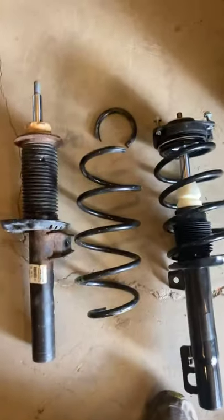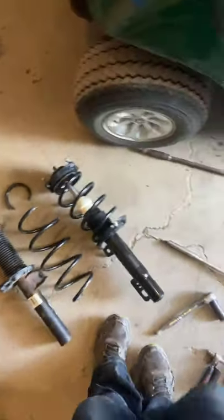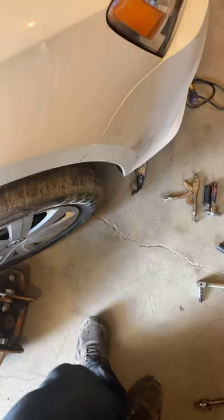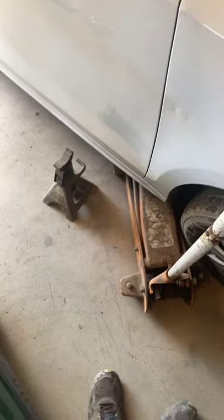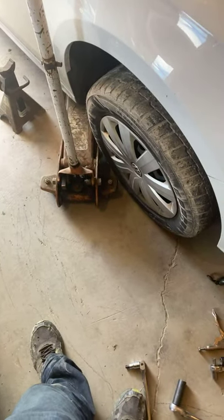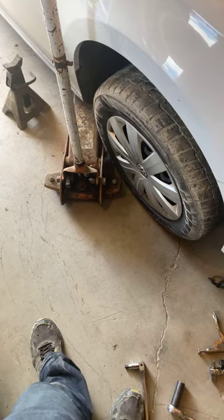So it started a couple days ago. I heard a clunking in the front, so sure enough I looked at the driver's side — we have a broken coil spring right here. So I went online, ordered a new strut assembly, and then realized that it was a 55 millimeter. Of course 55 millimeter does not fit. So in the description I'll post a link to a strut assembly available for a 50 millimeter. A lot of people were looking for one but not able to find one. I was able to track one down — actually two. I'm going to do both sides.